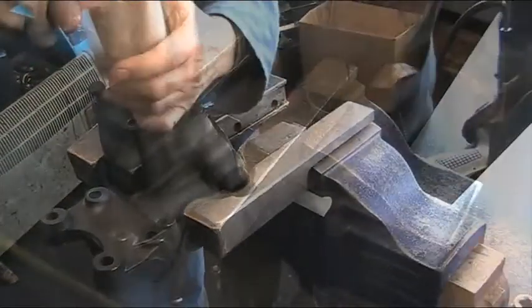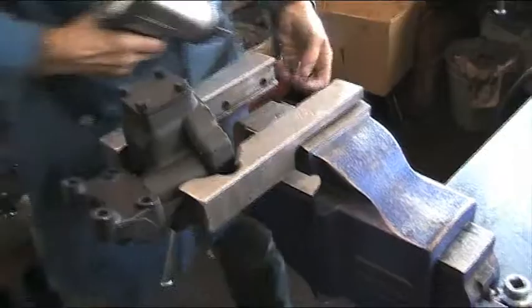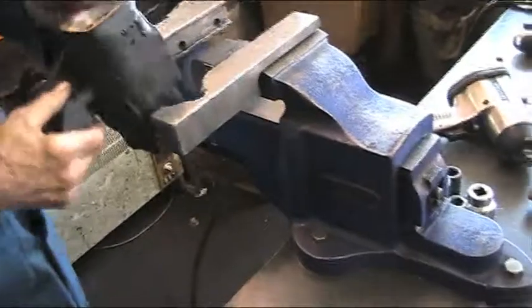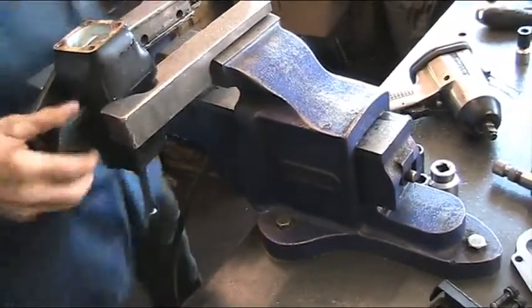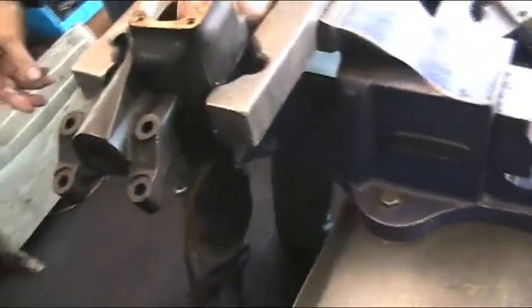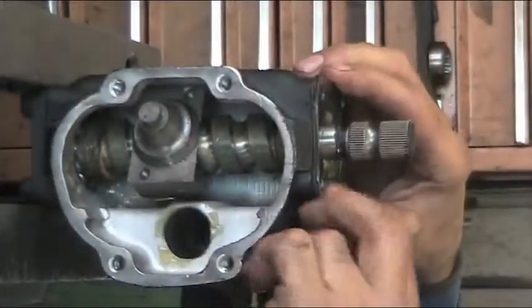We are reassembling using an internally pre-prepped box. The first part of the reassembly is the bottom cover plate and the positioning of the first race, ready to accept the new worm. Followed by the worm with a pre-assembled half nut with the balls and transfer tube, race shims, and cover plate.